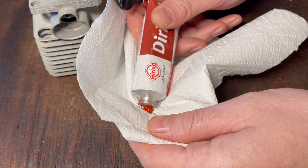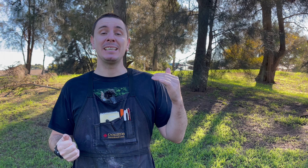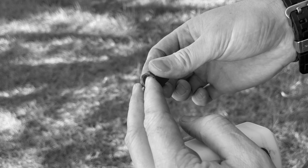but you risk contaminating the sealant, and therefore your engine repair failing. And you have to waste the first portion of that sealant from the tube to eliminate any of that Vaseline. It might not seem like very much, but when you do that 10 or 15 times, you can lose a considerable amount of sealant just to waste. Using Vaseline never really worked for me — I found I was just replacing one problem and frustration with another.